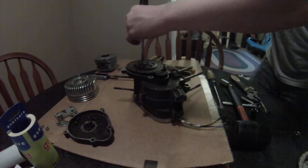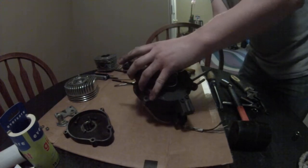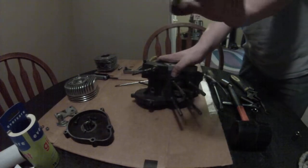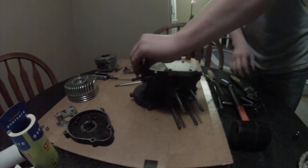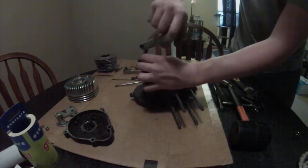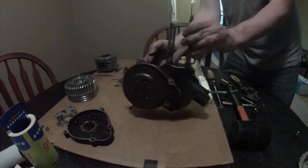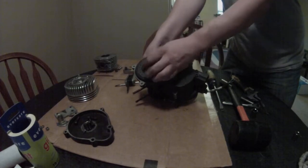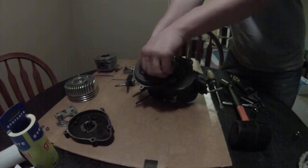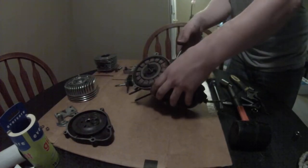Get the flower locking nut out of there. Watch out for your wrist pin bearing — don't forget about that, you don't want that going down the bottom end. Because I loosened this prematurely I can't tighten up the clutch, so hang tight. Here's the clutch — gauge the clutch so you can get the flower nut off. The clutch plate should fall off. Pull the spring out.